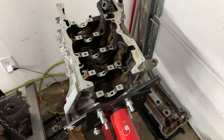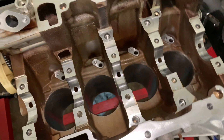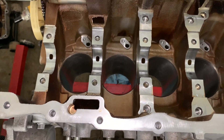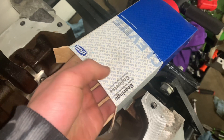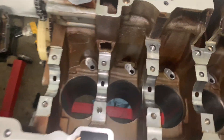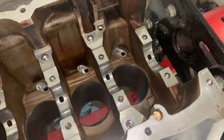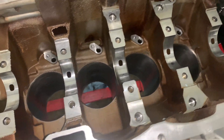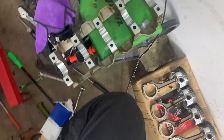Alright, now I'm going to show you guys how to pop on the main bearings real quick and get the crank back in and check the clearance. It's pretty short and simple. I was going to show you guys me clearancing the bearings for the main bearings, but I'm probably just going to do that off camera and then give you guys a look at how I clearance the rod bearings. First, we start off by putting this side of the bearings into the girdle.